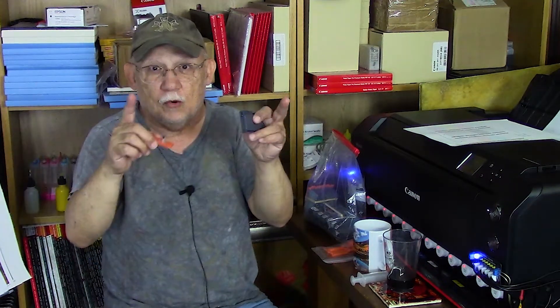That will remove about 99% of the water — you'll end up with a bag internally coated with just pure ink. Suck that little bit out to dispose of, and now you can refill with your 15 ml of ink. Once done, put this on a scale — look how clean that sponge is now. Dribble drop by drop until you reach about 32.5 grams or so; it differs slightly between cartridges because the bodies differ a little in weight even when bone dry.